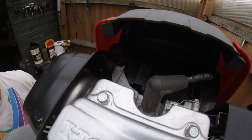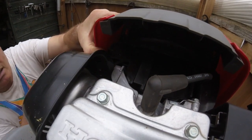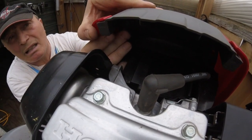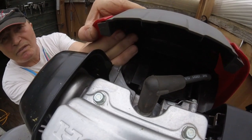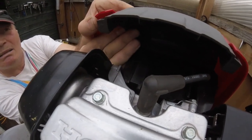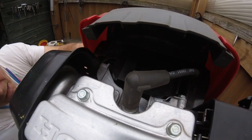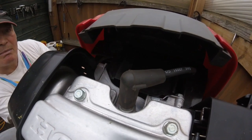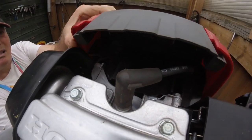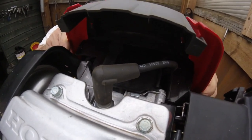I hope the camera is zoomed in enough for you. There is the plastic cover there — hopefully you can see my fingers inside. At the same time, push the top bit here with your thumb with the other hand and try to pull it in, and it pushes out a bit. Then down to the side one and the one at the back — get your finger under it and off it comes. So that's the front sides done.